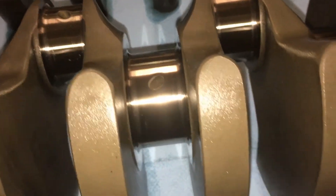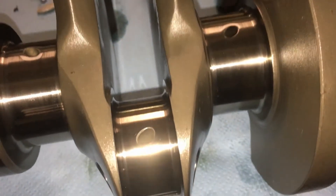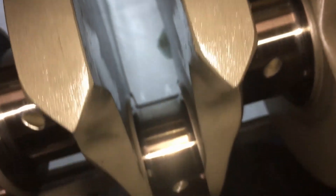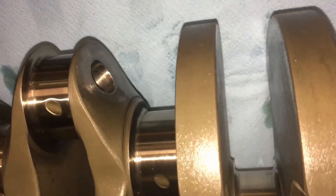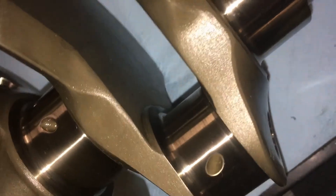The crank was pretty good overall, but there were some marks on the pressure side. I wouldn't necessarily call them scratches, but marks — so I'm definitely gonna take this to the machine shop for polishing. I can't really rotate it here so I need to take it to the shop. Last time I had the crank on the table I just used a very fine grit sandpaper and polished slightly if there were any leftovers from the bearings on the surfaces, but now I'm gonna take it to the shop.